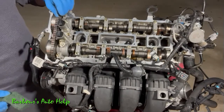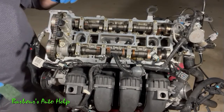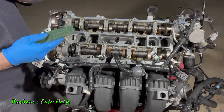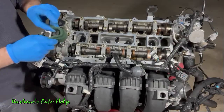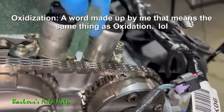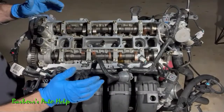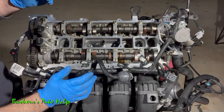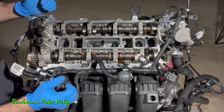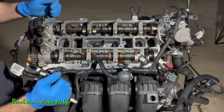Something else to note: these VCT solenoids get a little oxidized on the outside, which can affect the sealing surface where the seal goes over them. Take the scouring pad to the solenoids as well — a little penetrating oil helps — and work it around to get all that oxidization off. Once done with the scouring pad and all staining is removed, take another lint-free rag soaked with brake cleaner and wipe down the surfaces once more. After that, let it dry, then wipe down with isopropyl alcohol on a lint-free rag.